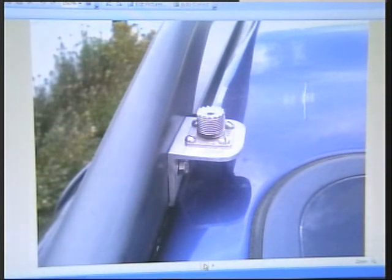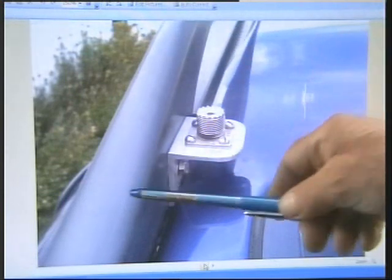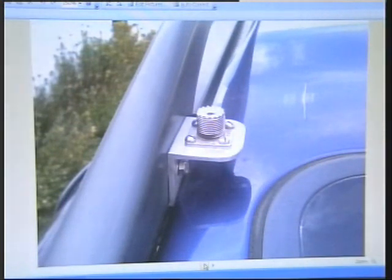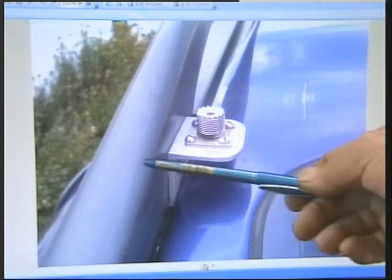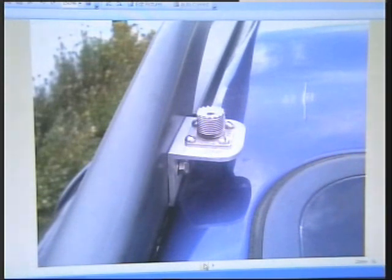Without interfering with the aerial mount. I can put a little plastic top on that for when it's raining if I haven't got an aerial, or going into multi-storey car parks and the like. But these rails are made of an alloy, and they actually help with the ground plane — not only the roof of the car, but these two horizontal rails. And it gives a good strong fixing. I drilled and tapped the two bolts.